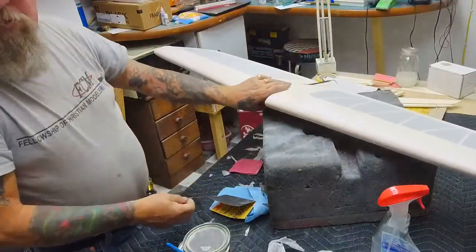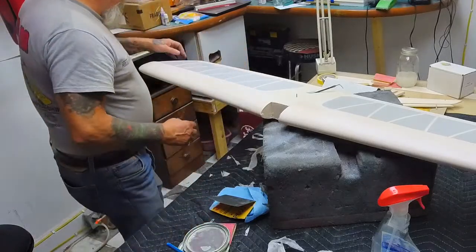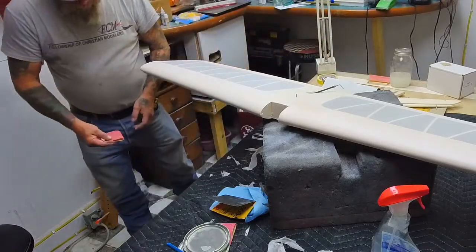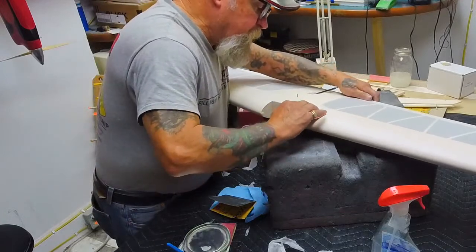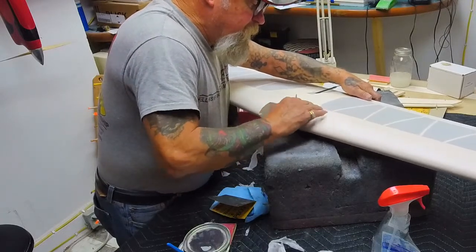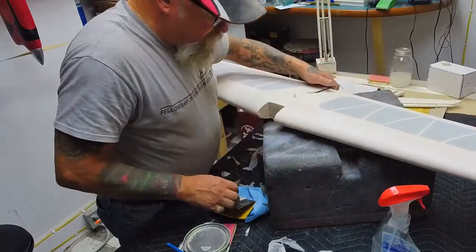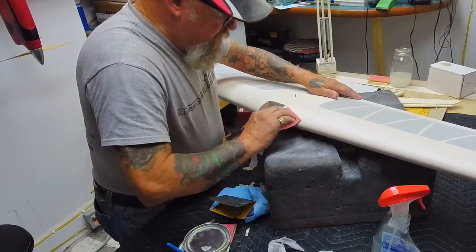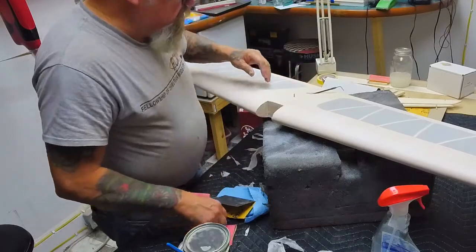The water and dope is pretty dry right now, so we'll just take some sandpaper. That's 180. Don't want to go that much. I'll take a 320 here. It's right here, and knock them wrinkles off. I mean, you wouldn't even really have to patch it, but I'm going to. Go around and sand out all the wrinkles.